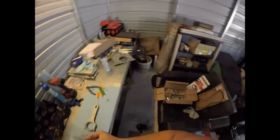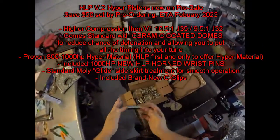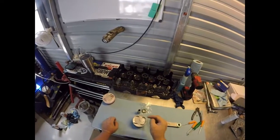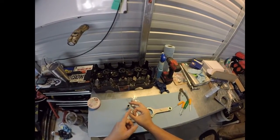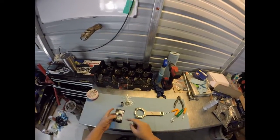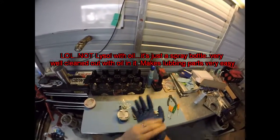Our Hafferland 800-horsepower J32/J35 piston sets come included with C-clips and all the wrist pins needed. We offer oversized performance wrist pins at plus one millimeter over. A lot of people get confused and ask if the pistons will work with OEM rods — and yes, absolutely. They are not wider on the outer diameter; they're wider on the interior. The wrist pins have the same OD as stock, so they still install into a stock rod.